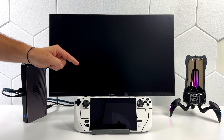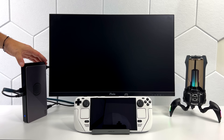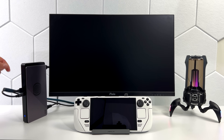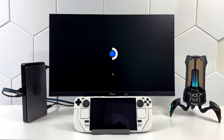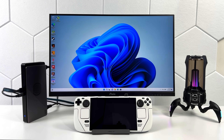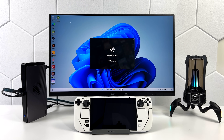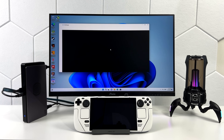Our video is going to be running from the G1, which has one HDMI and two full-sized DisplayPorts. Once it's all set up, you can set the G1 vertically or horizontally — it's really up to you. You want to turn the G1 on first, then power up the Steam Deck. All of the video is running out of the G1 eGPU, so we should see that Steam Deck logo, but we're running Windows. Remember, this won't work with SteamOS yet. It brings us right into the login screen. I've got a keyboard and mouse connected to the dock — just a wireless setup — and we're relying on the Steam Deck CPU, which is based on Zen 2. We've got four cores, eight threads, and it'll run up to 3.5 gigahertz. Even in Windows, it's running at 15 watts. There are some mods we can do to up the clock on this, but I'm going to leave it at stock clocks.